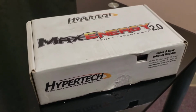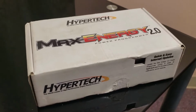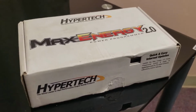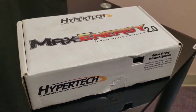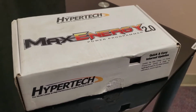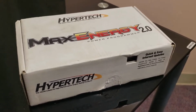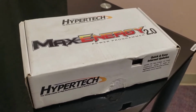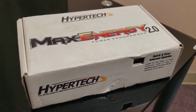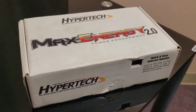But with this one, you can disable it for, let's say, less than 35 miles per hour, less than 45 miles per hour. The AFM won't turn on, but above that it will. So I can get some pretty ridiculous highway mileage, maybe 25 mpg with the V4 mode on and just cruising for like 25 miles. But in town, it just drives like crap. It kind of shudders every time it switches between the V4 and V8 mode.